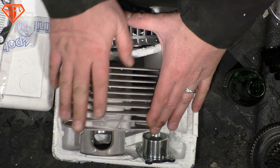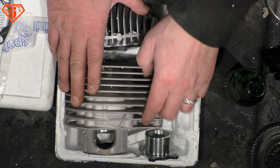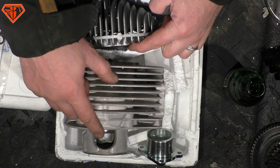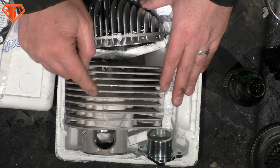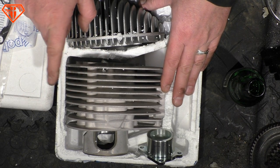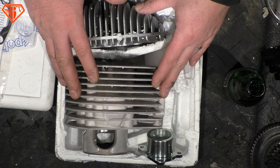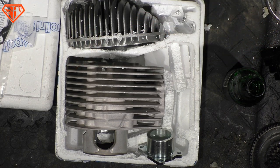It is a good update, yes, but again done as in 2010, and also for the 177 later on, it is not made with love. Cheap, O-ring missing, old ports, low timings. That's not state of the art. And you know, you have to consider, this is the most expensive kit. It is around 500, the Malossi Sport is 400, and it's just not worth the money. Yes, way better than the mk1. No, no recommendation. Don't buy it, it's too expensive and too old school. Done. That's not worth the money.